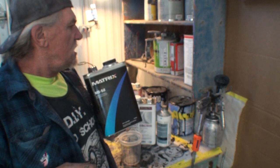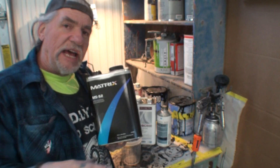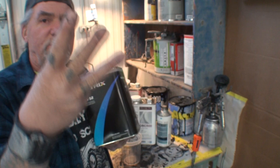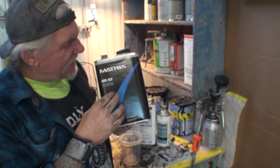So what most people do to do a flow coat or a double clear job is they take their urethane clear, spray two wet coats onto their items, let that dry for a week, come back, wet sand it out, possibly with 1,000 to 1,500, and then apply three more full wet coats. And then wait another week, and then sand. So we're waiting 2 weeks before we even have a painted panel that we can actually bolt on the car. We're waiting 2 to 3 weeks. And we're wasting a lot of expensive material here in the meantime.